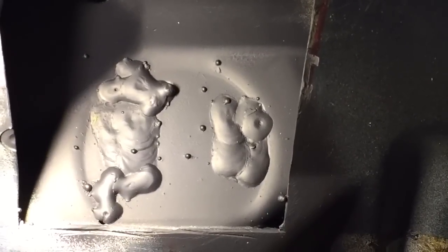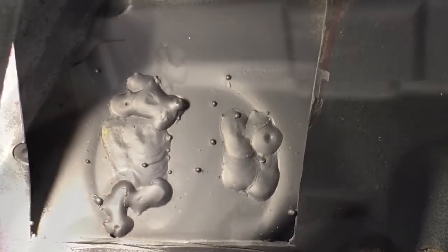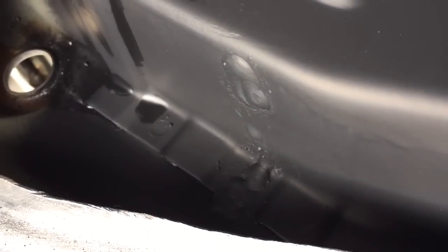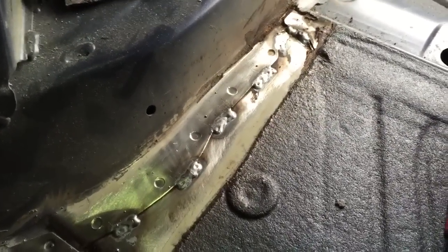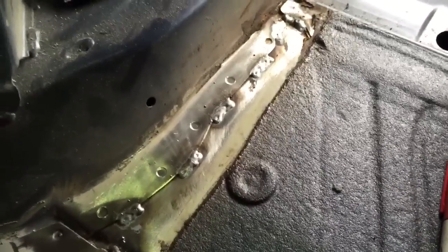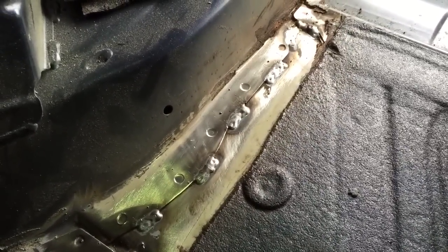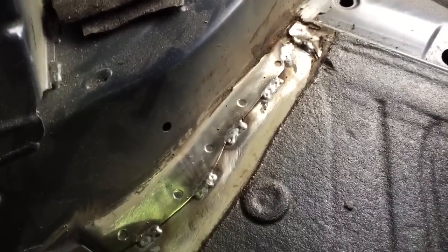There's the new MIG welds and also the crack repair, and that's now painted in etch primer and then high build primer as well. And this spot weld repaired up here, and also the plug weld and stitch weld, pulse weld coming up the panel, and painted in etch primer then high build primer. So there's a few stitch welds on the driver's side holding the rear axle carrier panel to the seat panel down in the left of the picture, the chassis legs in the center of the picture, and a bit of the boot floor in the corner up and toward the right.